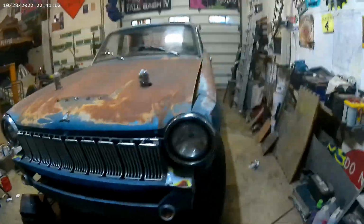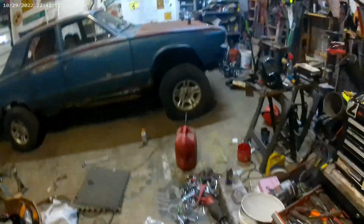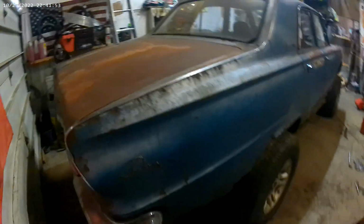I'm going to pull this thing out. I got to do a transmission in my truck. I tightened up the torsion bars this morning, raised the front end about 1.25 inches. I think I'm gonna have to recut the fenders and put them a little further. I remembered that I had these for a lift kit for a Cherokee up in the shelf up there, so I can use those on the back of this and raise the back up 2 inches probably, which will level it right out.